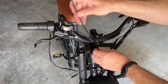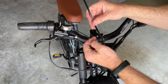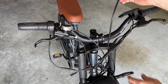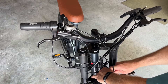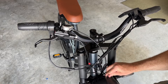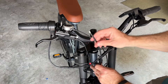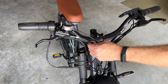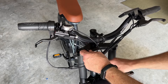The hydraulic brake cable is about a foot too long. I could cut it here, put a new swage on, and an olive. Or, in order to not cut the line, I'm going to loop it down behind the headlight so you don't see it. I'll put it over by this directional and loop it around under some of the cabling — it won't be so bad. I'll clean up the cable with the cable wrap so it'll be nice and tight.